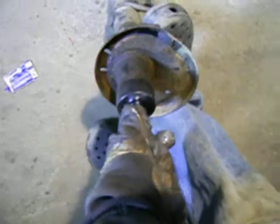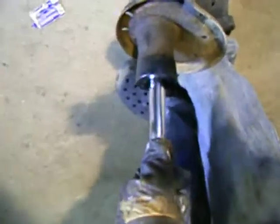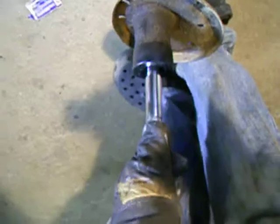And what I found as soon as I got it off is, and it's super cold in the garage so the oil's pretty thick, but the little short stroke movements like this, not sure if you can see, there's almost no resistance. Now the long strokes, there is some resistance, but this strut has about 1.5 inches of free travel. You can see better like that. That's all just about free travel. So this really wasn't doing a whole lot to dampen bumps and all that stuff.